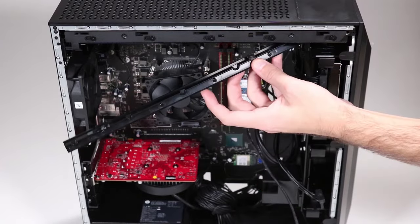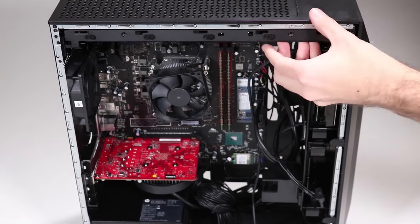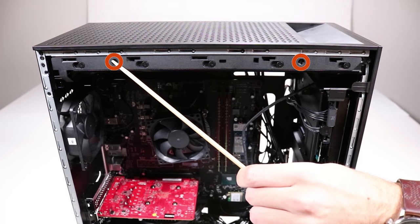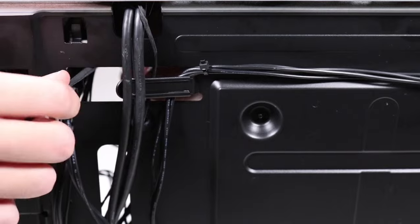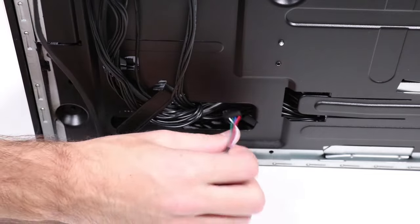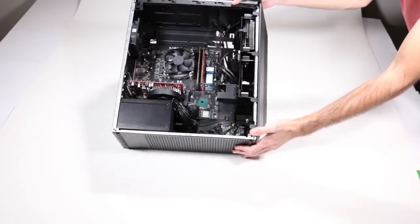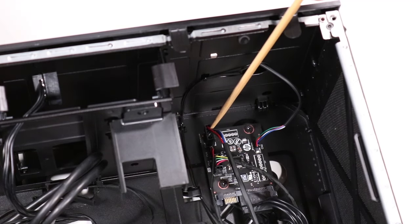Replacement: Place the LED lighting bar in position beneath the left edge of the top chassis and align the two screw holes. Replace the two P1 Phillips-head screws securing the LED lighting bar to the left edge of the top chassis. From the access panel side, thread the LED lighting bar connector cable out through the access hole at the top of the side chassis. Thread the cable in through the access hole at the bottom of the side chassis and pull it through. Lie the unit on its side. Pull the LED lighting bar cable connector gently to the lighting control module and reconnect it.